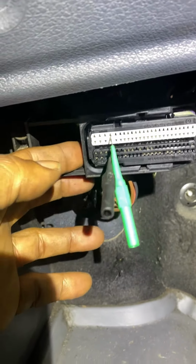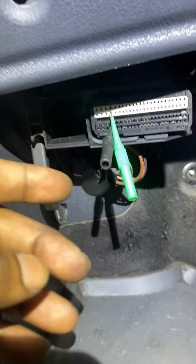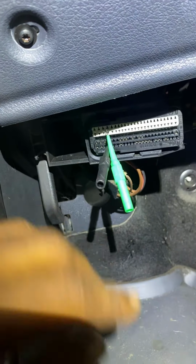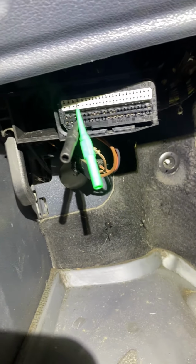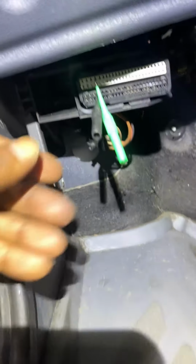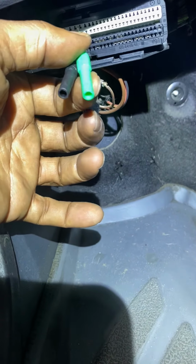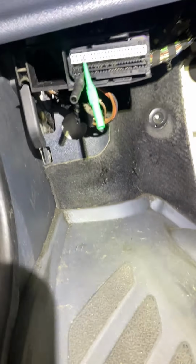So I went to the ECU, undid the plug, found the pins, which is pin 4 and pin 52, and then I ohmed across this with it plugged in up front, and it was reading open. So there is an open circuit. What I did next was, you see my jumper lead here, right? I went from each wire on the plug to here, and then I checked for continuity, and sure enough, one of the wires, pin number 4, the red with the white, was open. It's broken.